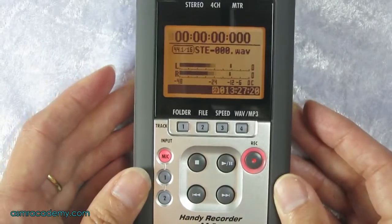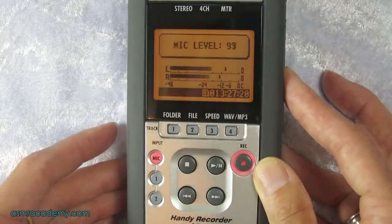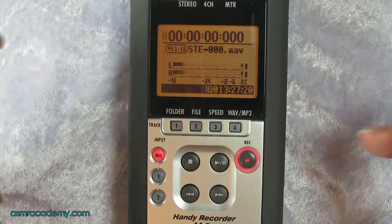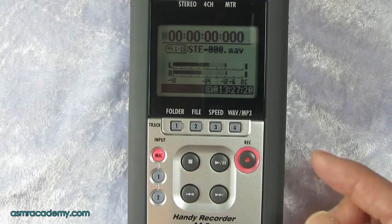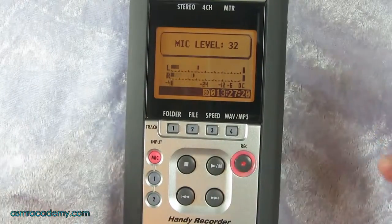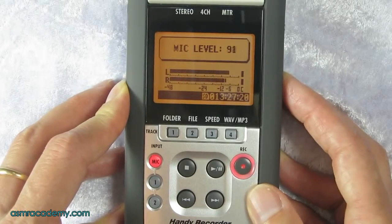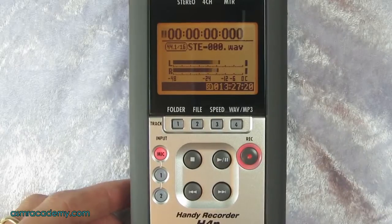The other thing to think about is distorting the sound. If I turn it up too high — say up to 100 — and I talk, it's actually not clipping in this case, but if I flick my fingers, watch this little microphone button flash. When it's flashing like that it means you've got the recording level too loud. So if I was doing that finger clicking I'd want to move it right down. Once it's not flashing, you've found a better level. For my voice I'll keep it around there.